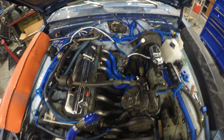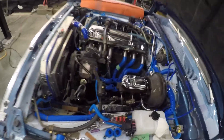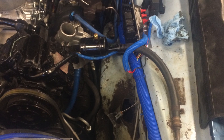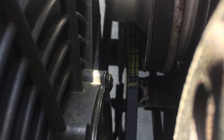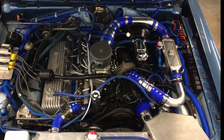Once we decided to throw a turbo on the car, things got more interesting - I needed even more airflow through the radiator at times. I also needed more outputs from the ECU, so rather than control the fans individually I switched to both being on or off together. This worked and seemed adequate until we did a very long road trip through the South. On Route 66, the inexpensive cooling fans that came with the radiator package both burned up and had to be replaced on the road.